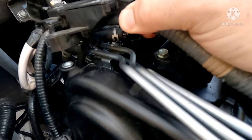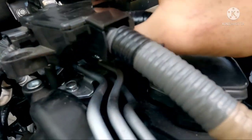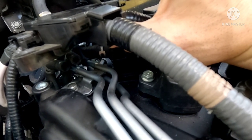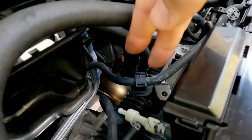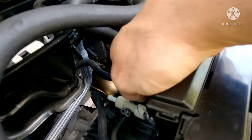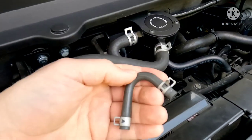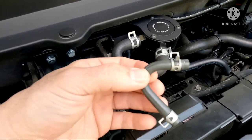So you're going to lift this up. As you can see, I have two open hoses right there — they're not connected to anything. That's where you're going to be doing the bypass for this setup. Originally you're going to have this T right here — mine's disconnected — going into your intake manifold, which is where this hose is. This is the bypass — the little connector that goes into the intake manifold.